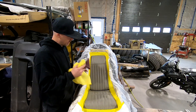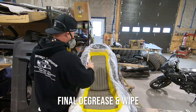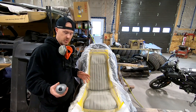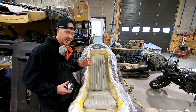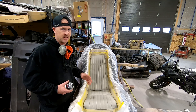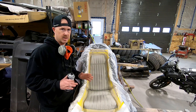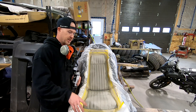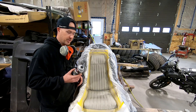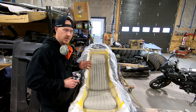One last rub down with the scotch pad, one more wipe with brake clean, and then we'll get to spraying. We're about to apply the second coat — usually wait about five to ten minutes between coats; it dries extremely fast. That said, it doesn't mean you can sit in it ten minutes later. I'm actually going to let these seats sit for at least three days indoors in a climate-controlled space to make sure everything cures before installing them in the car. I still have the knee bolsters to do in black as well.